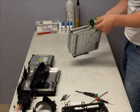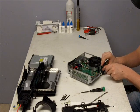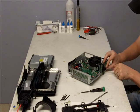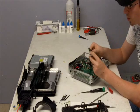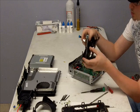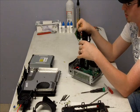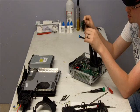Basically, you've got your RF module in the front, held in by two black T8 screws. Take those two out and the RF module comes right out. Now, one thing to be aware of: there is a ribbon cable on the face plate. It has a locking mechanism that goes around the clip. You have to be careful when taking off the face plate — this will rip your ribbon cable and you'll have to get a new face plate. Make sure to take it off first. All you have to do is pull that tab up, pull the clip forward, and pull the ribbon cable right out.